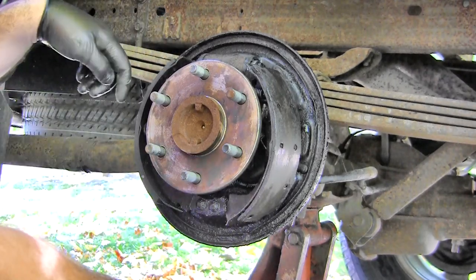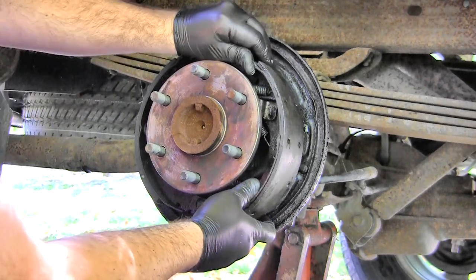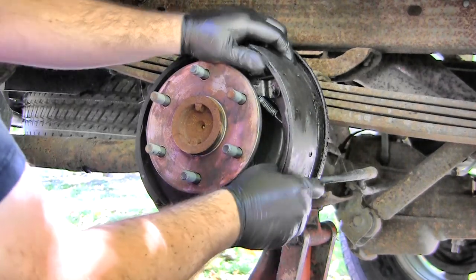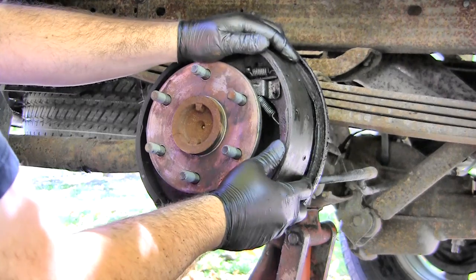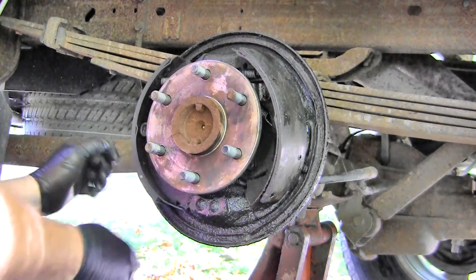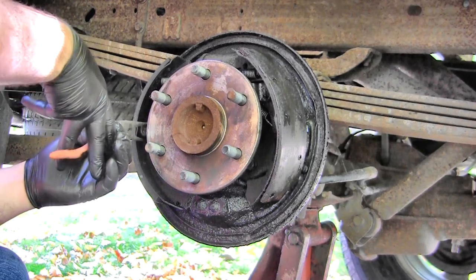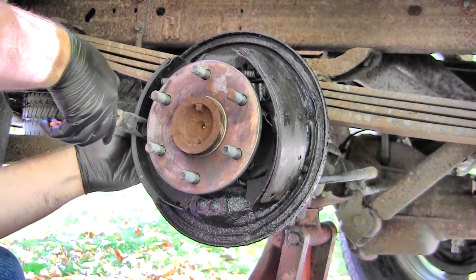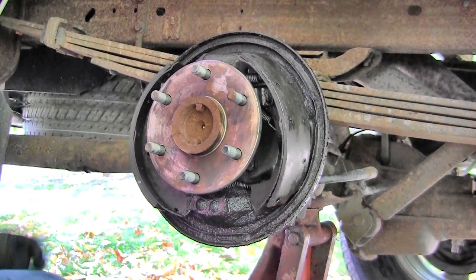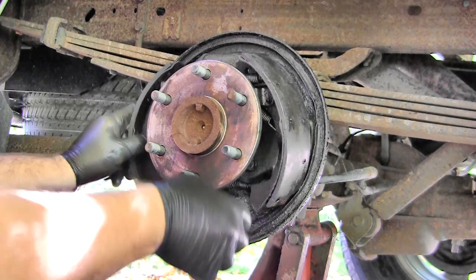And the front side, which would be the non-parking brake side, would have the adjuster lever on it. Which doesn't really matter, but this top spring is what's going to hold them together. Oh, and I've got to get my keeper spring off here. It should be as easy as twisting and turning until it lines up, hold the back, get that off there. There you go.